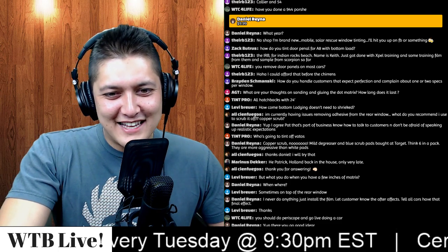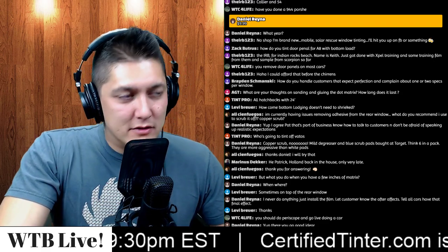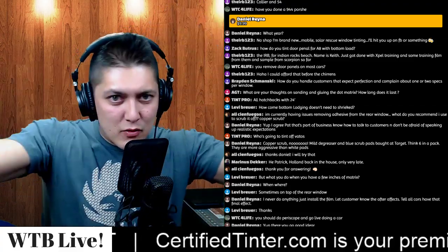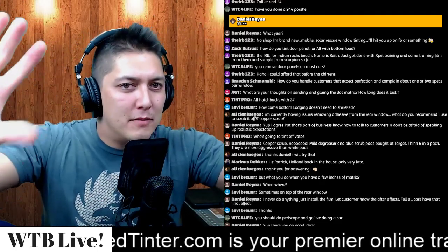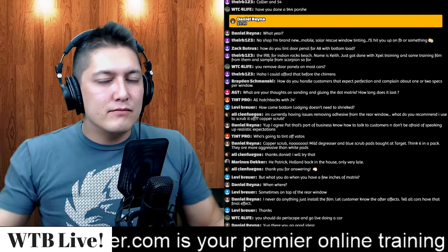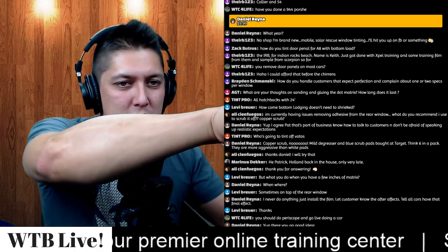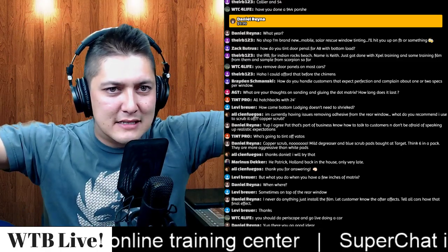You killed it on the last name. Yes. What's my squeegee pattern for back windows? I'll get the film in place and put a tack right in the middle, just a good hard tack so I know the film isn't going to move on me. Then I'll go from the center out to my left, and then center out to my right. Now I know that it's down solid.